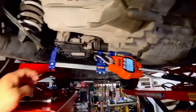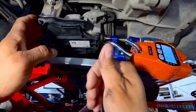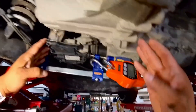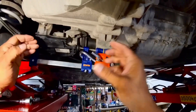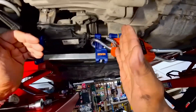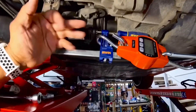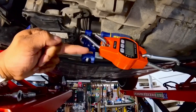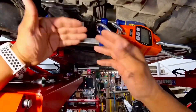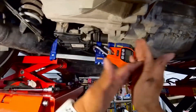The manual says put it in there and once you feel it go in three lines — but there really are no three lines. As your clutch starts to wear thin, this has to work further or lesser, so it has to be calibrated correctly mechanically. It's got to be up against there, and then you do the clutch relearn so the pressure's just right — the clutch learns how much pressure it has for first, second, third, fourth gear.